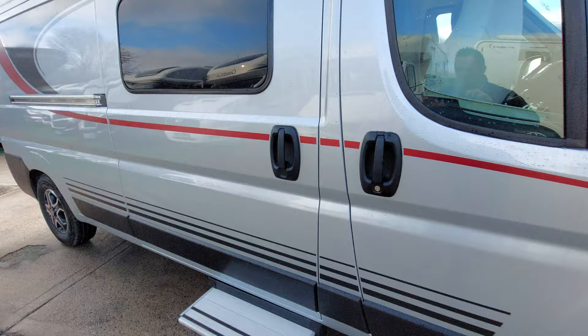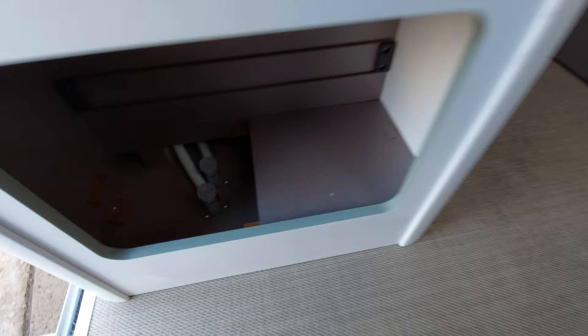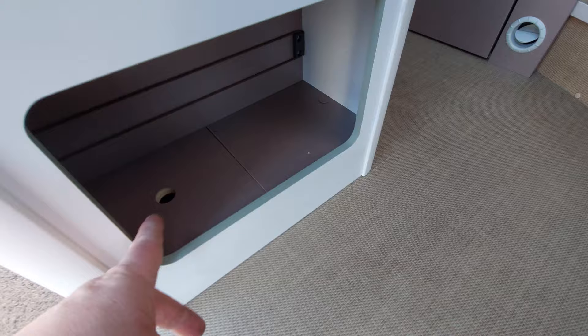That's the outside of the vehicle done — let's move on inside. When we come into the vehicle, in the compartment next to here, you'll see there's two little valves — these are your water drain valves. You've got to turn them anti-clockwise to empty and clockwise to fill it up. If you forget, water will come out directly underneath the van, so remember those two when you're draining down the water system.